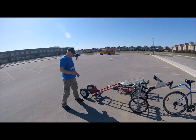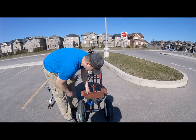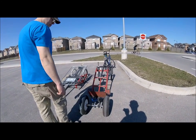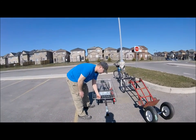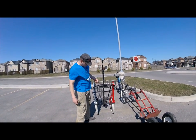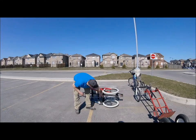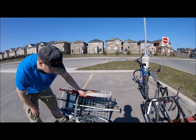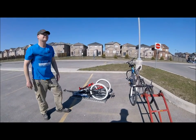Come closer. So this one we built with two bicycle forks, we locked them in place with two screws, we have a one inch solid axle with a bicycle seat post in the middle over it, dual bearing wheels, and the rest is just a two-wheeler frame with a metal bar pipe. This one has the arm reinforced with a square piece of tubing. The rear end is all connected right to the center, and then you have your rear hitch point for this when you want to hook another trailer. You can change your tires easily — it's all 20 inch bicycle tires, and that is that.